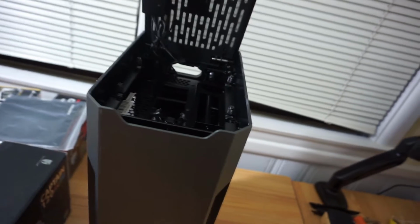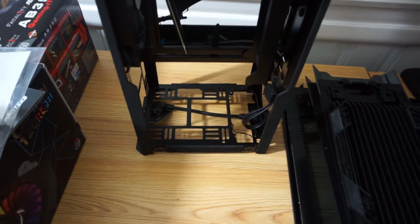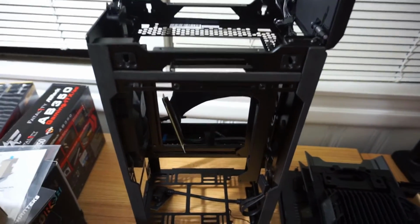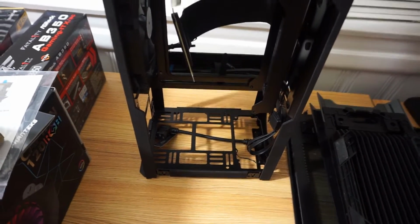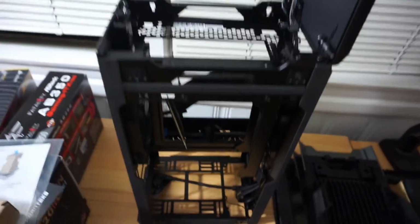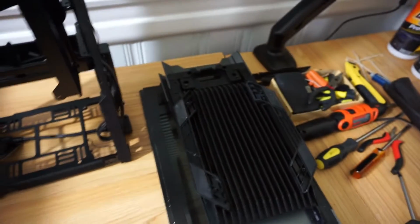Thumb screws on all sides, everything comes off. These screws are not screws to remove the glass, they're feet. Alright guys, so here she is all stripped down and ready to be worked on. Under no circumstances do you put pads to insulate the power supply from the chassis. They don't need it for vibration. Power supplies do not vibrate and make noise today. And isolating the chassis, theoretically, would not be a good thing, even though it wouldn't be isolated with tabs on the bumpers. So, no problem there. Just, I think water cooler radiator first, then power supply. That's one thing you got to do, is look at it logically and see the order of things and how they're going to interfere with each other or work with each other. Alright, so we'll be doing that.